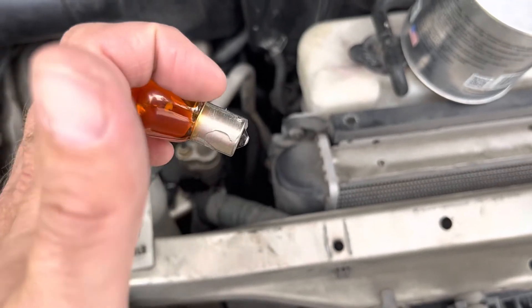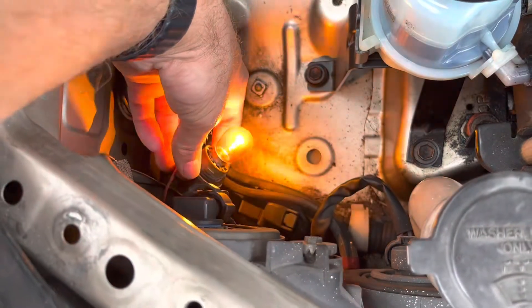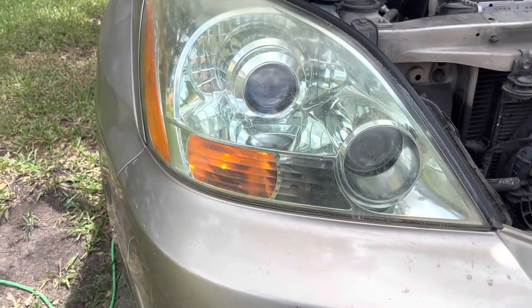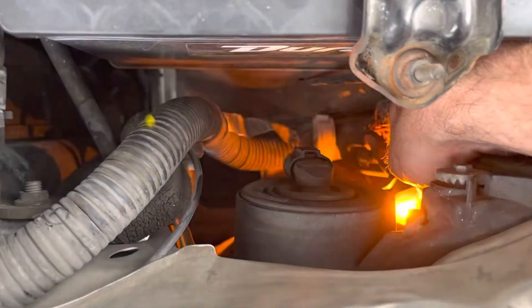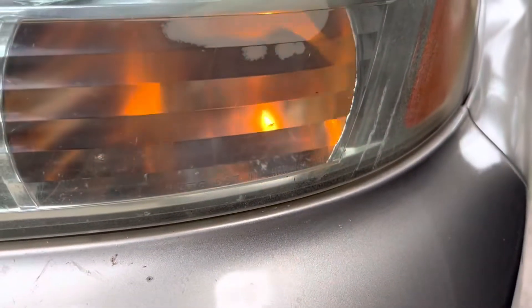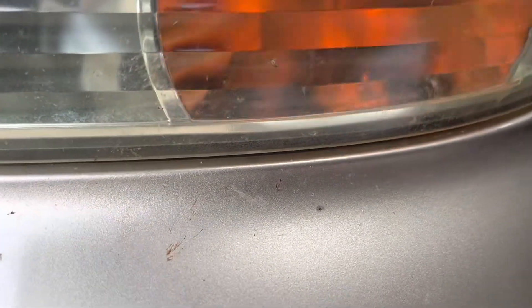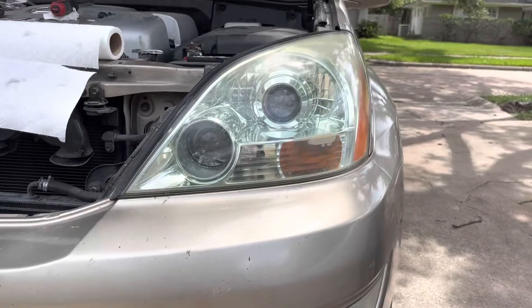I've got essentially where the contacts are going to be made coated. Now we'll just put it in, give it a little eighth of a turn clockwise, and reinsert it. Make sure it blinks well before we put it back together — which it does. Reinsert it and notice you've got about a quarter turn clockwise to lock it back in. Getting it down into that socket is easier by feel. As soon as it gets in front of that hole you know you've made it. Get it seated, turned, and locked in — make sure you get a good quarter turn. That's how you change the front turn signal bulb.